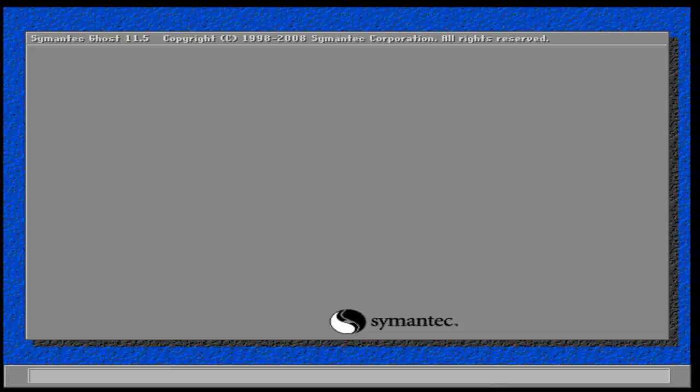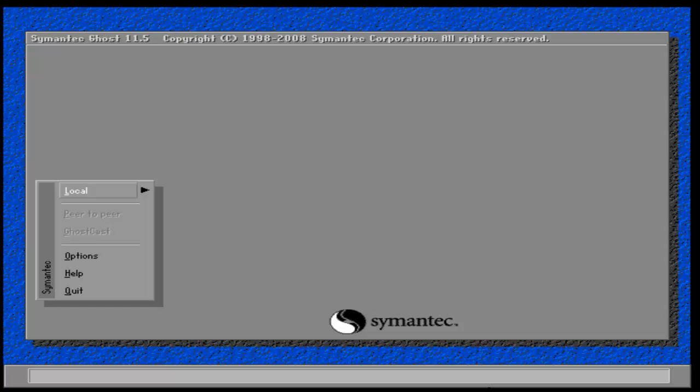And that's okay, I guess, if you're using NTFS, a file system that supports large files. But I like to use the split option with Ghost for two reasons. You can use FAT32, which gives you more versatility about hard drives and things that you copy your image files to. And also, generally when you use smaller chunks in a file and you do a lot of copying back and forth from one drive to another, it seems like you're taking less of a risk of that file becoming corrupted. Very large files, when you start to copy them back and forth from drive to drive, tend to have problems sometimes.